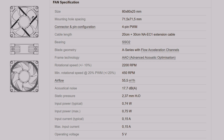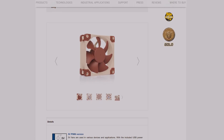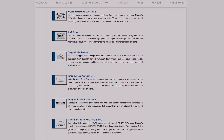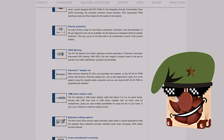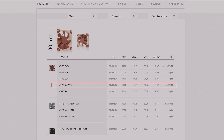Also surprisingly, they consume only 0.75 watts, while most other fans at this spec consume at least 2 watts. It's incredible how Noctua is able to deliver all of this with little required power. If you are familiar with Noctua, you know they make the best computer fans, and that's why I chose them for cooling the Aero GLI. I'll link the fans page in the description — please make sure to get the 5-volt model that works with only USB, not the ordinary 12-volt one.